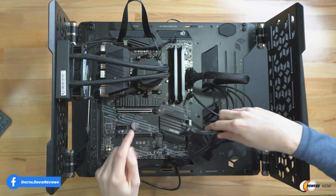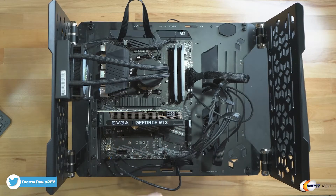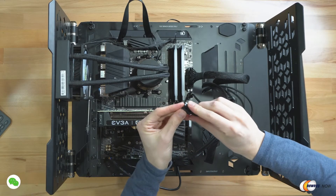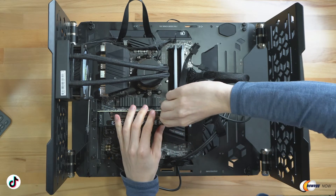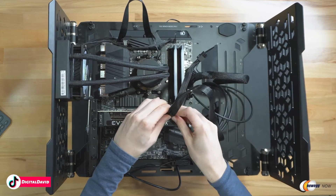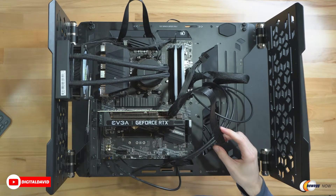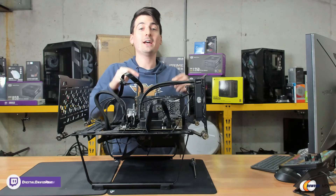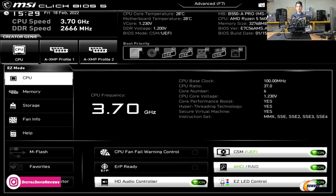Line everything up gently and then just press in place — wiggle it in, and there we go, just snapped in. That is now successfully connected. Lastly, you can see we have our PCIe connector, so let's go ahead and get a graphics card installed. We've got our EVGA RTX 3060 installed — we're going to take our PCIe connector, line everything up, and gently press in place. There we go, we now have our power connector installed for our GPU. Let's go ahead and boot it up — everything is plugged in, powered on, and working great.